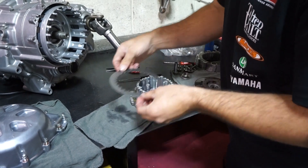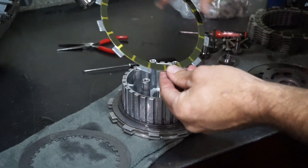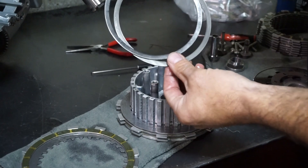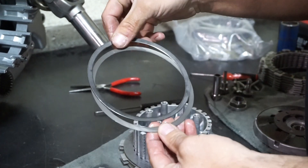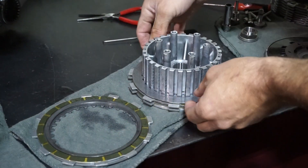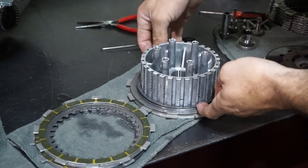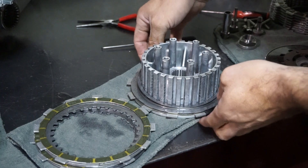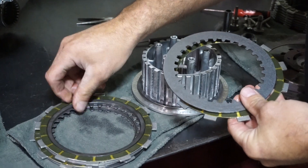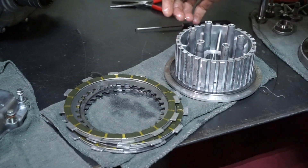Now we can go ahead and pull the steel. If you look, this friction plate is a lot skinnier so it's got a bigger ID. Then it's got two washers behind it — you'll see there's a flat on the bottom and then on the top it's a bevel washer and it says 'outside.' There are going to be three sets of these just like that. So another steel, another big friction with the bevel washers. I'm just going to pull all of them off — those bevel washers, same thing. Another steel, another big friction, and then these last bevel washers.